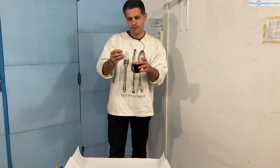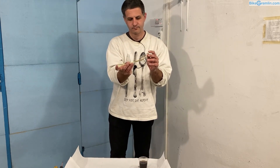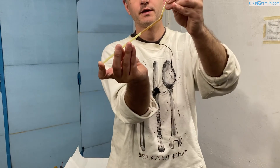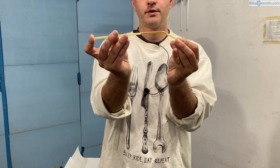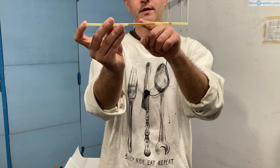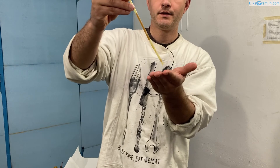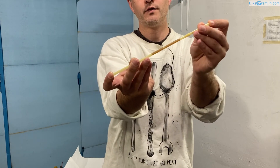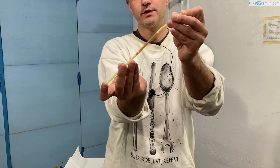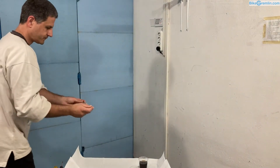If you have trapped air inside, it just won't work unless you have both ends open. As you can see, this is our brake fluid, and when I close both ends it's not going anywhere — we cannot remove any air. But if I release one end, it starts flowing. Here we have two parts that have some liquid and this is air in the middle. In order to do anything, I need to open both ends or it won't move. Here we have an air bubble moving up and down. In brake systems it's difficult to get the air out unless you have some open canister. If it's all enclosed, you won't do much work. You need to open both ends and bleed the system.